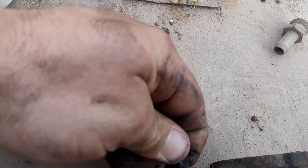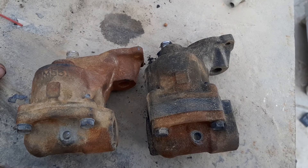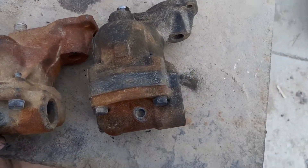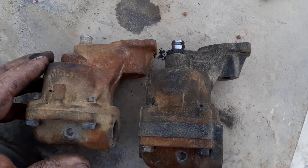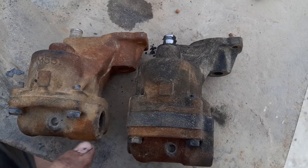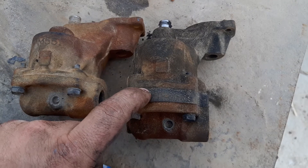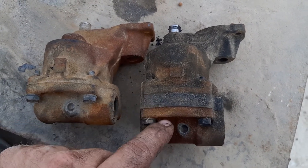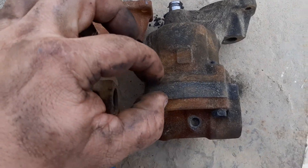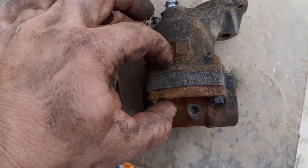It's pretty gnarly right there on the shaft, so it might just be a GM. Big difference between the two is the housing height. The housings are exactly the same left to right, and the bottom inlet housings are the same left and right. The difference is right here and in the gears on the inside. This one is about half an inch taller, so it's going to have a half inch spacer that's actually bolted in here, and the gear is that much taller.